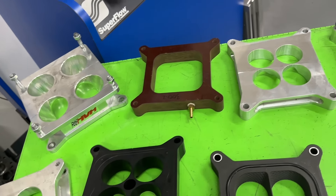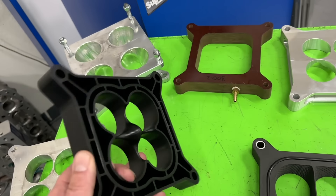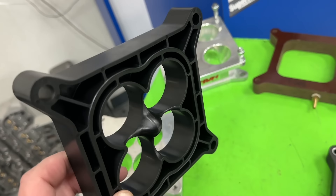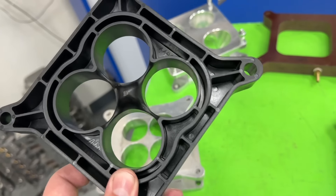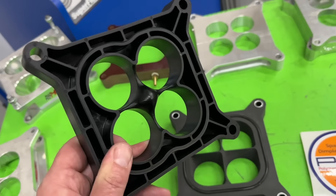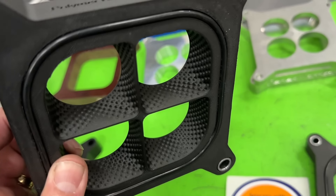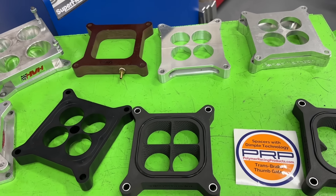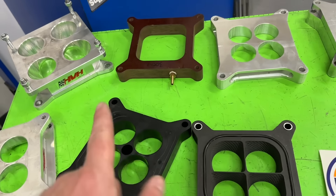Here's what sucks — if you take all these spacers, this one was only better by about three to four horsepower, and when tested on a manifold without a spacer, adding the spacer only gained eight horsepower. So the others might have gained about five. The test I'm about to show you compares this AFR spacer — the best of the 4150s — versus the dimpled tapered spacers. Let me clear this space and show you the manifold that was used, and I'll talk about why this one spacer is the absolute best I've ever tested.